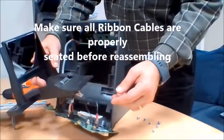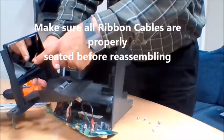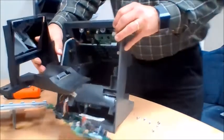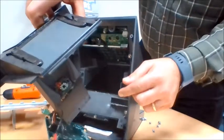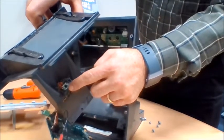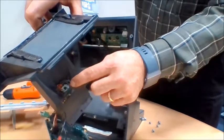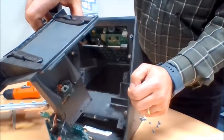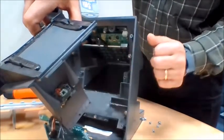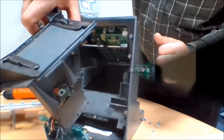Once you have this out, you can then clean with a Windex and paper towel the mirror on the inside. You then also have the camera here, where it has the nodes around a little black window on the inside. Take a paper towel and Kleenex on there and make sure that that black window looks clean to the eye.